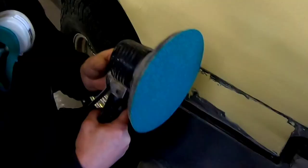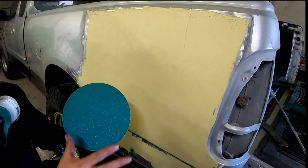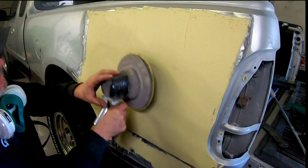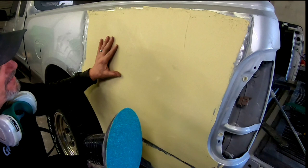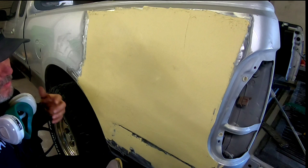There's no way around it — this is a lot of sanding on this filler, so I'm using 36 grit on my mud hog. This is an orbital-style sander that's really going to shred this body filler and get it flat. After it's cured, we're just going to flatten this out. We'll need another coat of filler, but first we want to level it out, remove the roughness, and start shaping it — going in an X pattern, following the contours of the panel.